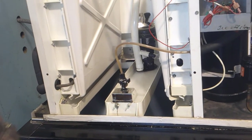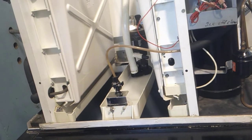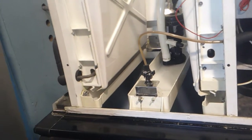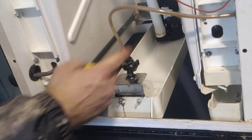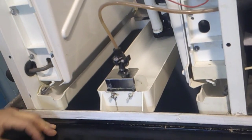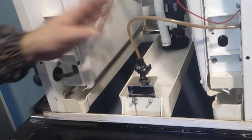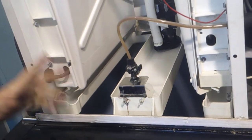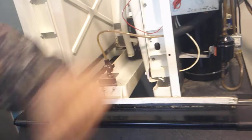Our dump valve solenoid back here is energized and is piped into the drain system. What's happening now is this water is leaving the reservoir and going down the drain. We have fresh water coming in at our float valve — this is our inlet water valve where the city water comes in through the hose. This has a float on it, just like a toilet would operate. The float valve has dropped because the reservoir is empty, so it's bringing in fresh water and flushing out that reservoir. In just a few seconds, that solenoid valve will close, the reservoir will fill up with water, and our condensing unit will come on — which it just did. So we are now in the freeze cycle.